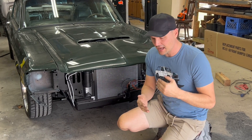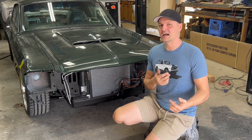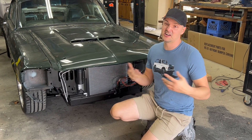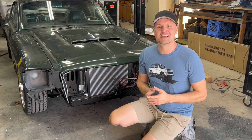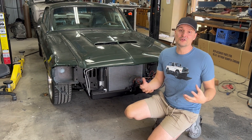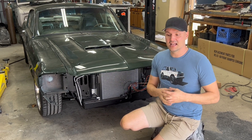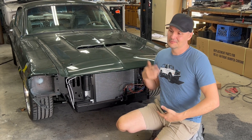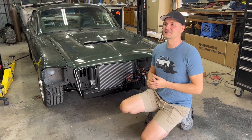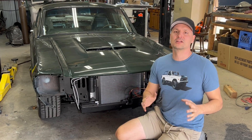The one thing I think I'll have to modify is the return spring. When I depress the brake, it doesn't return back like I'd expect — I anticipate it's because there's already a spring inside the Honda Accord brake. Let me know your thoughts; I'd love your help. I don't know if this could fit into the Coyote yet, but eventually I'd like to put this inside a Coyote swap as a brake system solution, since we all know how compact the engine bay gets with a Coyote. Please hit like and subscribe — it really helps the channel!